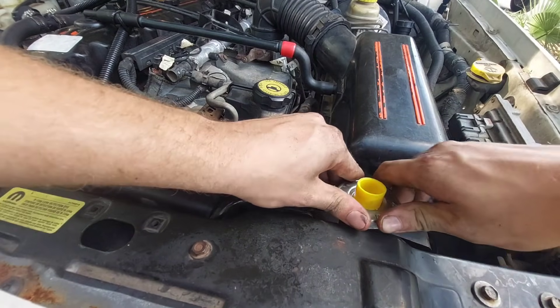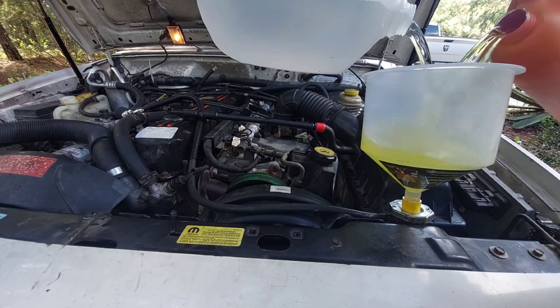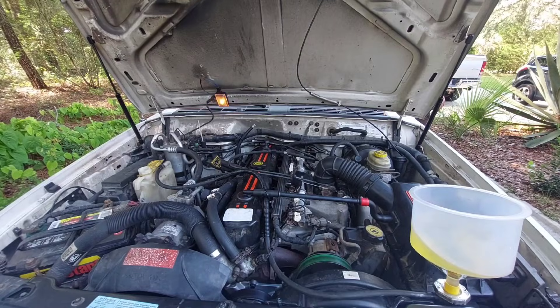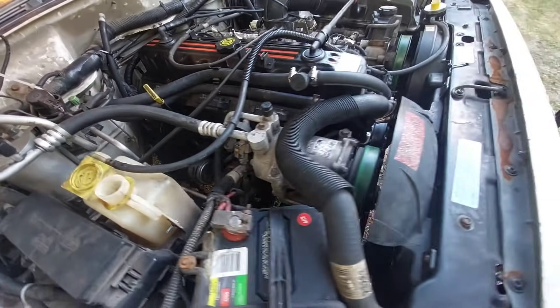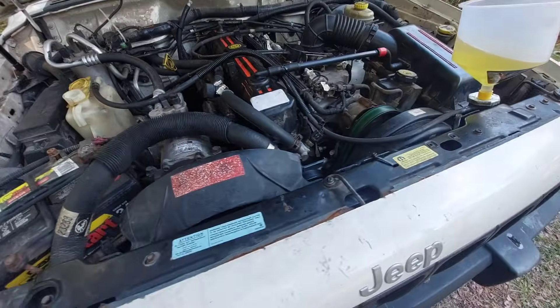This port will let me hook up a hose and pump water through the whole system — it'll come out of the radiator cap, so I can flush it regularly without having to take everything apart. Now, using a spill-proof funnel with the XJ attachments, pour in a 50/50 mix of antifreeze and distilled water. When the funnel stays full, start the engine and let it idle until the thermostat opens up. While idling, check over the whole system for leaks.